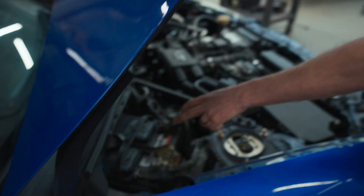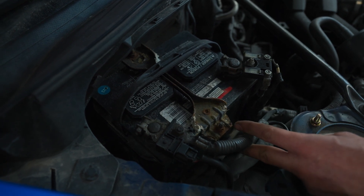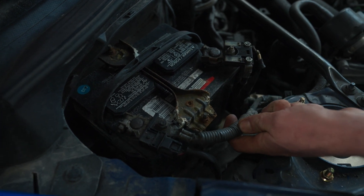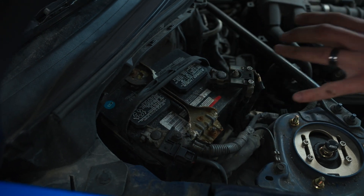For myself, I really like the OEM style terminals, especially because they usually have built-in fuses. This one's got the current sensor in it. So what I'll normally do is just end up cutting the cable here and I'll do a butt splice from here to the one in the trunk. You keep the OEM battery cables nice, good fit and finish.